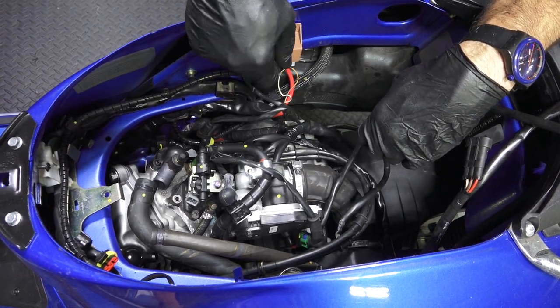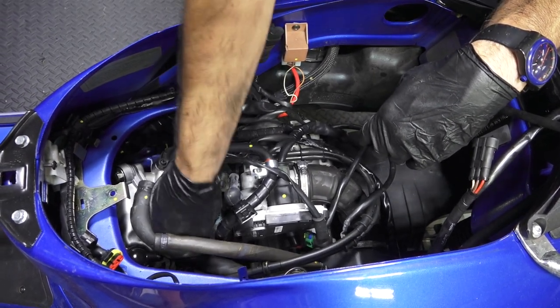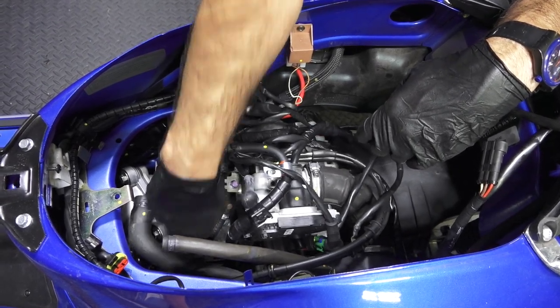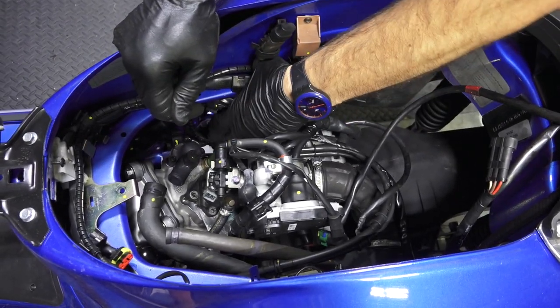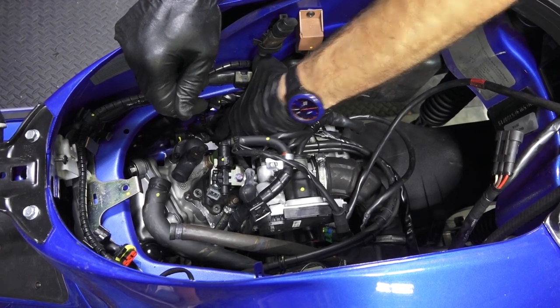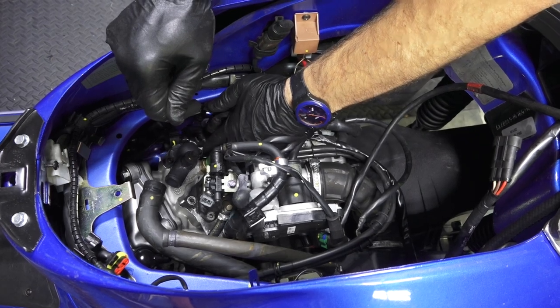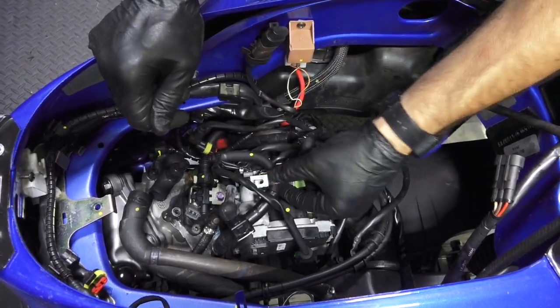And down there is a spark plug cap. This hose, make sure it doesn't come loose. I still got a piece of foam that's in the intake manifold. Very critical that the fuel line is routed underneath the intake manifold. See, it's wiggling right there. Earlier models had two hoses.